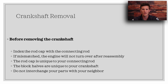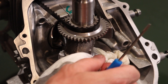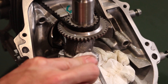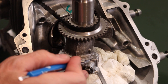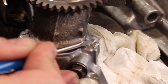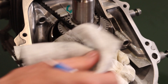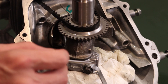When you've made sure not to interchange any parts with your neighbor, go ahead and get an instructor's signature for having the crankshaft removed from your engine. Now, you'll notice there are no unique identifying marks anywhere on this connecting rod assembly. The observation isn't entirely correct because it is stamped on the other side, but there is no unique identifier for this particular connecting rod to this particular cap. So what I'm going to do is take a screwdriver and scratch a mark in a unique spot — the chances of scratching another one in the exact same spot are pretty slim. That identifies and indexes the correct direction of this rod cap and the correct rod that this cap goes to.